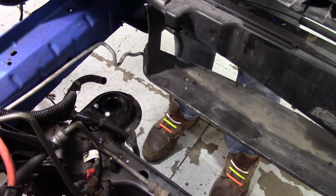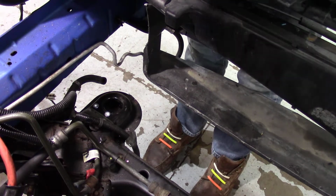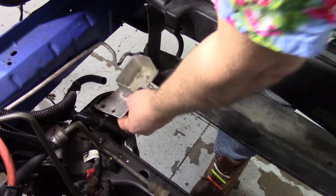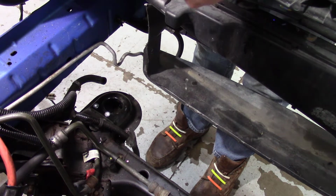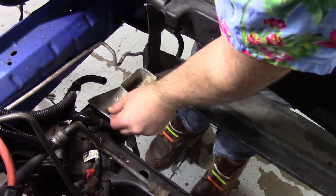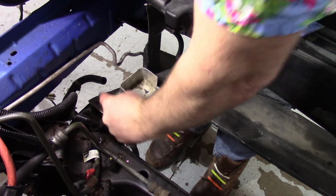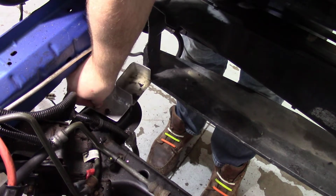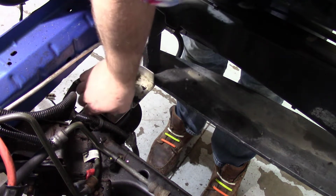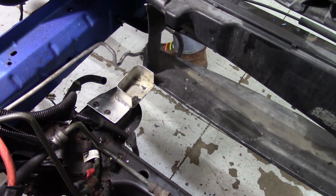All right. So as you can see, I like to drop the nuts and bolts. Otherwise, those two riv nuts here that are in this frame, I went ahead and TIG welded up some simple aluminum mounts for the radiator that we had to upgrade to. So, again, this was before they had so many quick fixes for the G8 cooling system when you hopped up the engine. So what we did was we spec'd out a Howe Racing radiator, and then I TIG welded up the mounts. So, let's see how that goes.